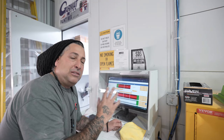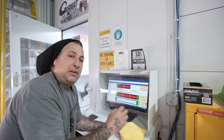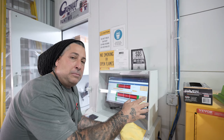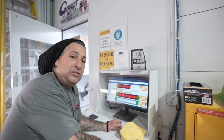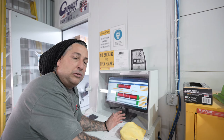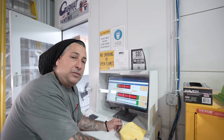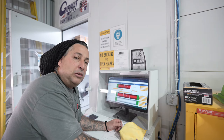I called Pat, I said, what's going on? He says, do not go with the adjusted. Sometimes it will go to the extreme and it will turn that color the wrong way. So if you have a 90, he recommends going with the original shot that you have in the camera, and that's what I did. And then that color blended out beautifully on that white BMW with the code 300.